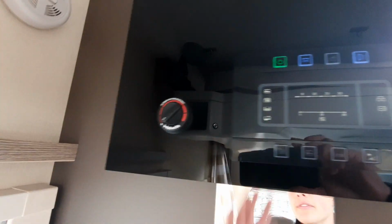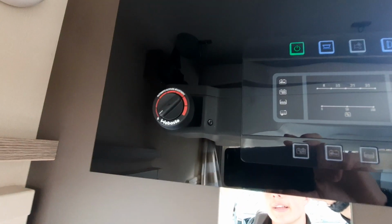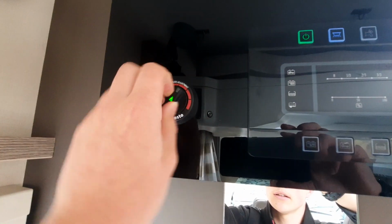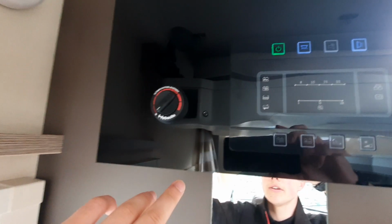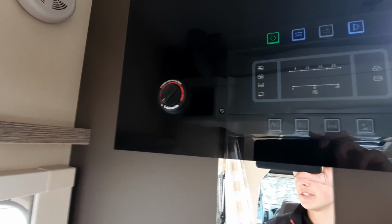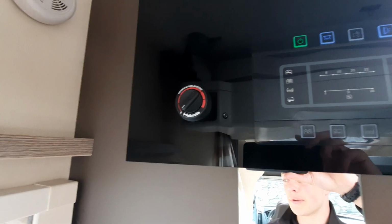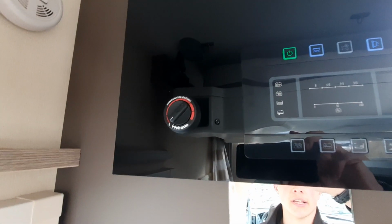Once you've finished on your control panel, moving over to your Webasto system. Your Webasto, as I say, is diesel heating. To operate this, all you need to do is turn this. You'll notice a green light will come on. Just turn that off for now. Once you've turned it on, you'll notice all your lights will start to flicker. The reason being is because it's powering up the system. It draws a lot of power, so it'll start flickering. It'll flicker for approximately 15 to 20 minutes, and once it's powered up, it'll stop flickering all your lights.